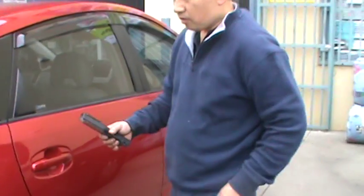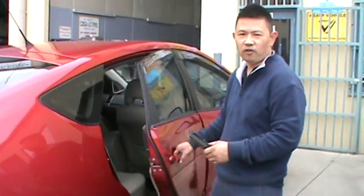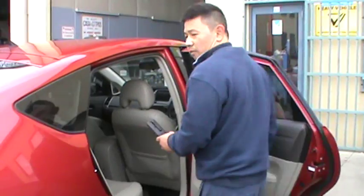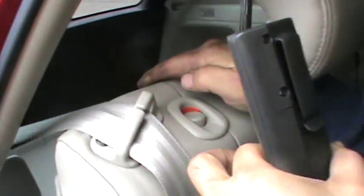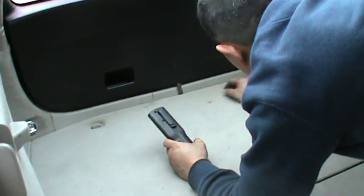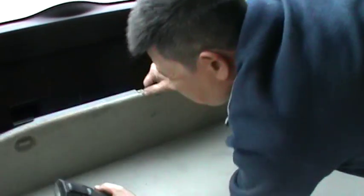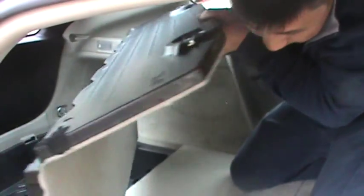Because the car's got a flat battery, we can't actually get into the boot. So what we're going to do is go via the back seat. So what you're going to have to do is see this button here — flip down the back seat with your fingers, both sides. So we're folding down the seats, and what we're going to have to do is undo these clips just by twisting it, then pull this back. Once it gets pulled back, you need to lift this up so it's out of the way.